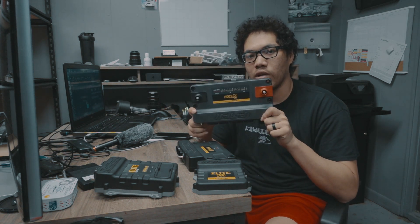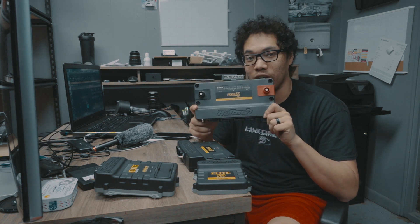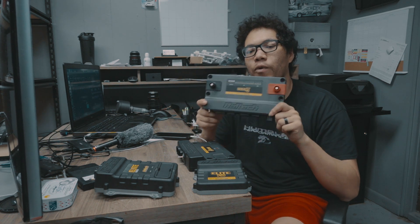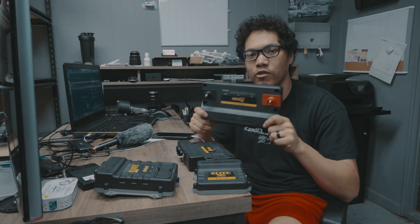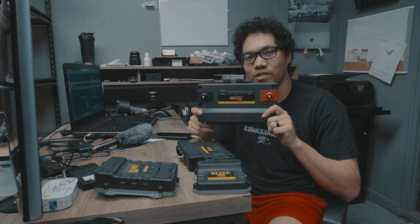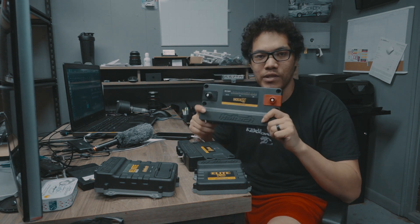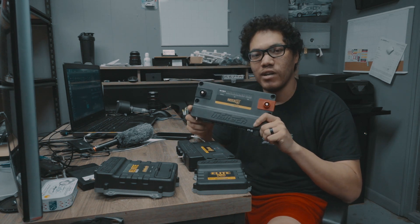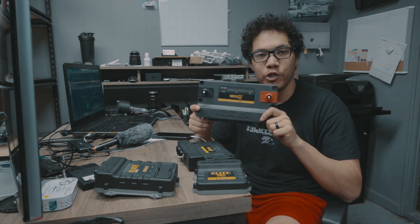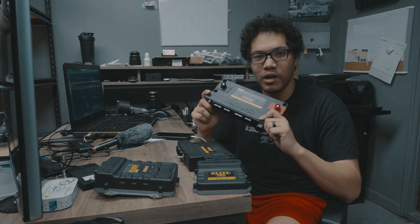Above the S2/S3, we have the Nexus R5 — the top of the line. I would say the R5 is not going to be applicable to 90–99% of you guys. What this is, is an ECU and a power distribution module in one box. I would recommend this if you have a car stripped all the way down to the bare chassis with none of the fuse boxes, and you want to simplify your wiring. The PDM is effectively a fuse box inside the computer — all solid state — so I can monitor which channel or relay is using how much power and see if it over-currents.